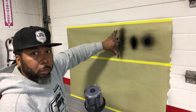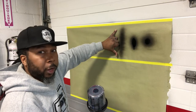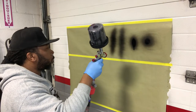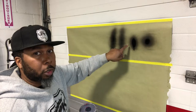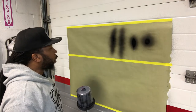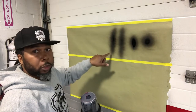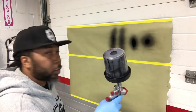That's getting us where we want to go. We're starting to get that football pattern right there. You kind of want to be within five to seven inches on your fan pattern. We're looking good right there — not bad at all. One pattern is already starting to run, so that's what you want to stay away from. You don't want it too close to the panel or your material starts running on you. You want a football-shaped pattern about five to seven inches with tapered edges.